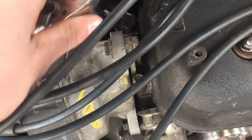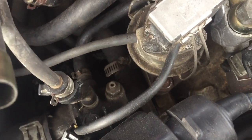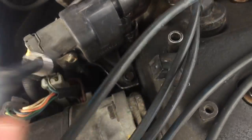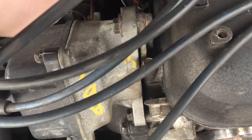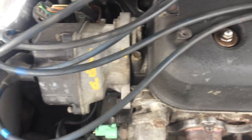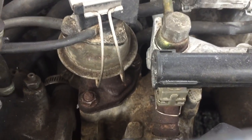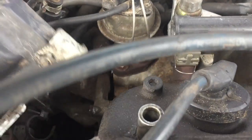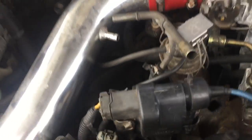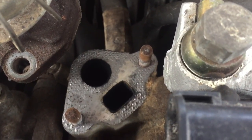To start, you've got to get the coil pack out of the way. There are two 12-millimeter bolts - one right there and one back there. Move those and then just move the whole coil pack over to get it out of the way. Once you have it moved, it's just those two 12-millimeter bolts and then you can lift the EGR off.